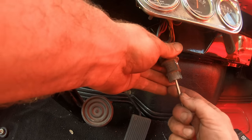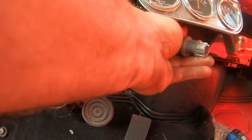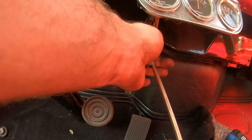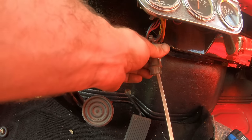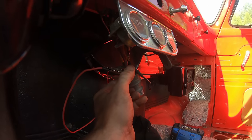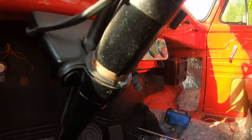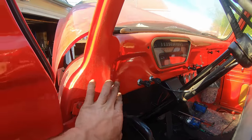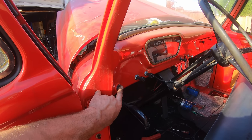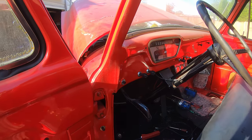There we go, got the tumbler out of there. Now we can use the ignition switch. See what that does. Nothing. Yeah, silly me, I figured it out. It's a very simple switch. I just jumped it, and then this red blue actually comes over to this side, and this is the starter. So, and here we go. Yeah. Turns over nice and smooth.